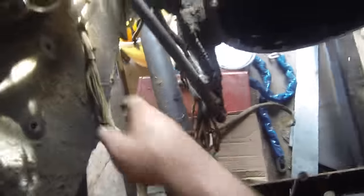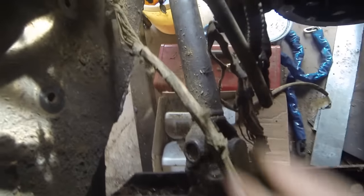That's actually inside the chassis, so you wouldn't even know if that thing went. Yeah, the insulation is perishing on a lot of the wires there, and that's buried right deep inside the chassis. I think it's about 450 quid to get a complete new wire loom, so that'll be okay.